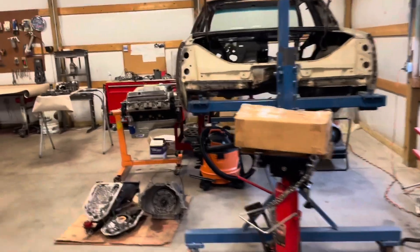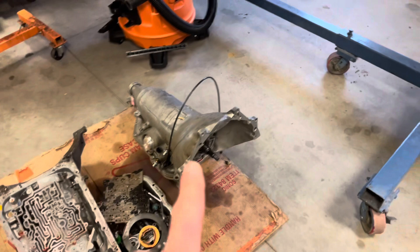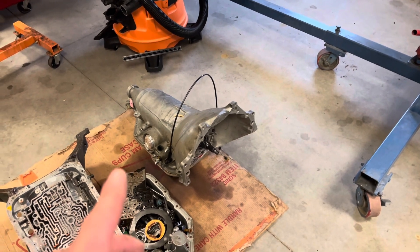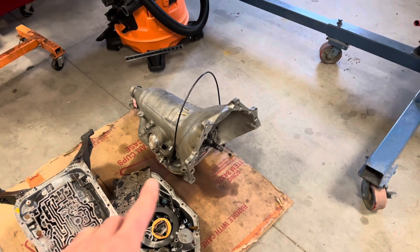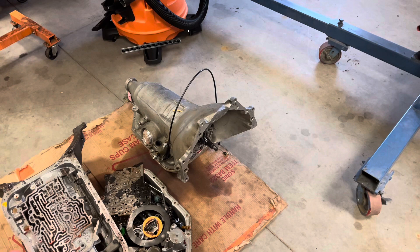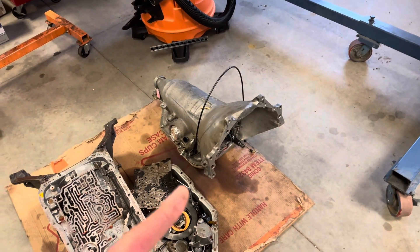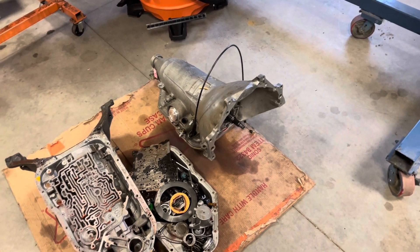This car sucks — that transmission is done. That was the one I was working on. Before I put the valve body on, I did an air check. I was going to use the Transgo servo, but I said screw it, I'm just going to put that servo in and see what it does. It's fine. My concern was because I ground the pin — I was afraid the clearance was going to be too much, but it turns out it's actually fine.